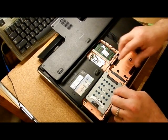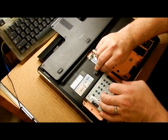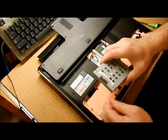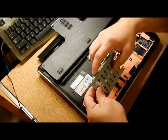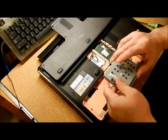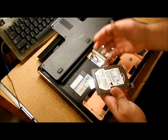It's nice to have two hard drives — you can put all your data on one, and if this one fails, your data is protected on the other. To remove the hard drive, move it back, use the pull tab, and pull back and up. There are channel ways that these guides go down. When you put the hard drive back in, it has to sit in those channels. You have four screws to take out to pop the hard drive out.